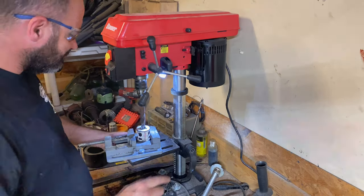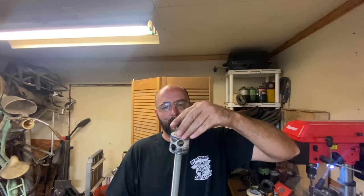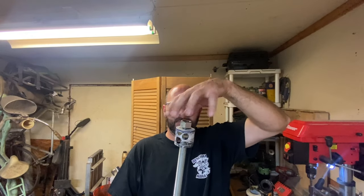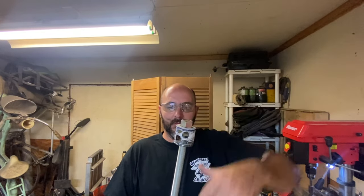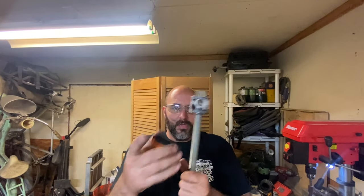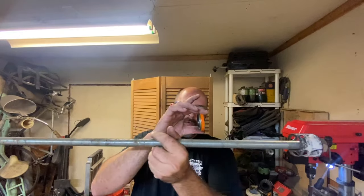but not that dumb. This will drop down on here, and then I'll be able to tighten this up through the center axle disconnect port, and the seal will sit in here like this, and I will be able to tighten the nut up on this side and pull this whole thing into the housing. Start tearing stuff off the truck, and you'll see me there.